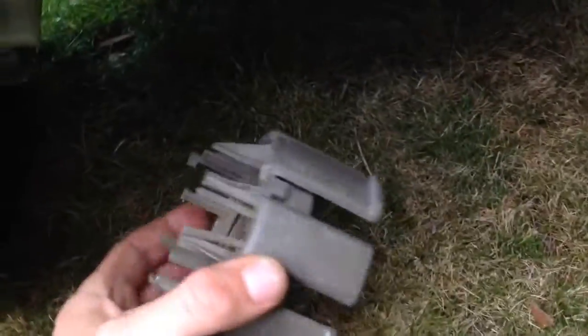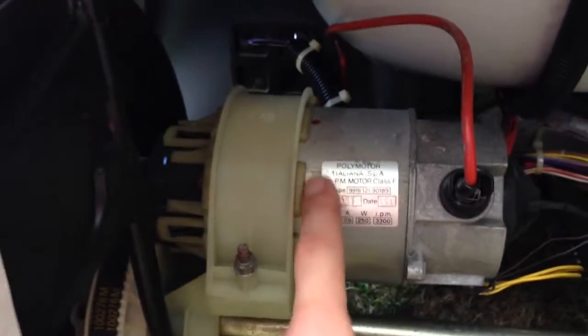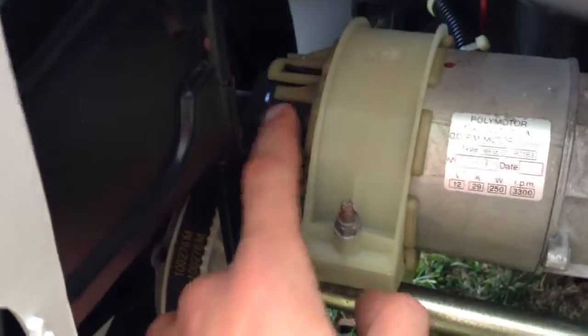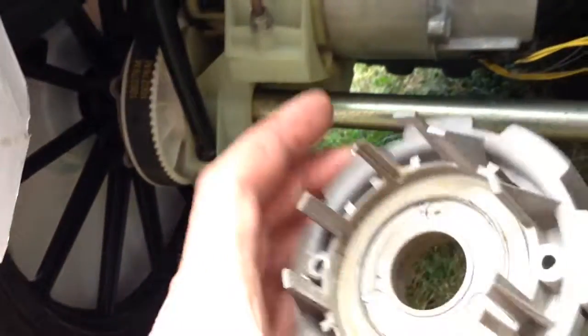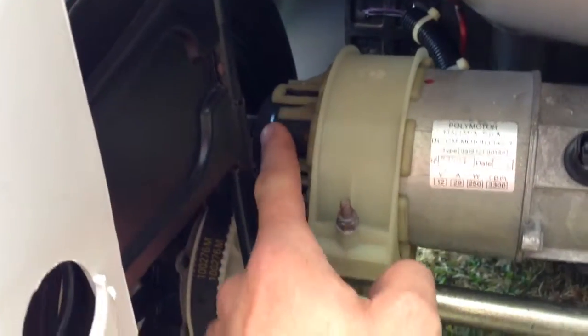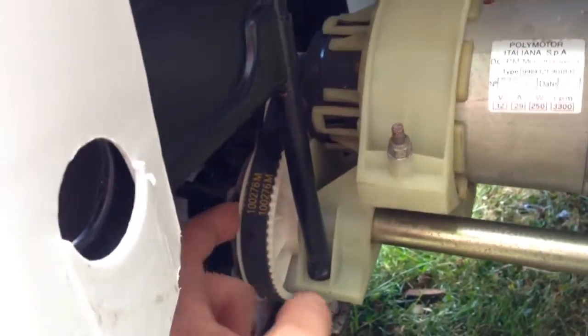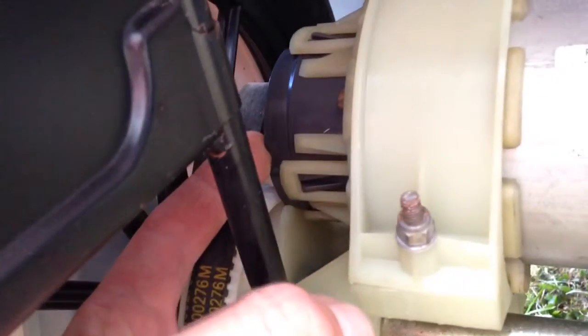So this was completely destroyed — this original brown fingers item here. I've now replaced it with a brand new, new old stock, original white-fingered gearbox holder, along with the original brown gearbox, which is in really good condition inside. Where the teeth broke years ago, the gearbox had fallen down slightly, and that had meant the driver cog started rubbing a groove into the brown gearbox — you can just about see it where my finger is. Just a bit superficial really. Put the belt on, drives really nicely.